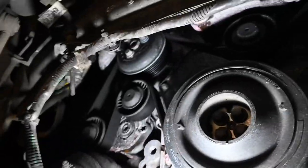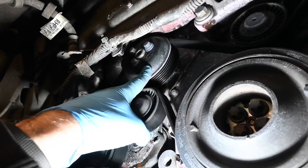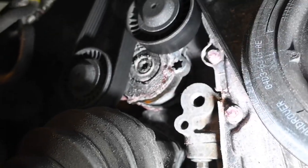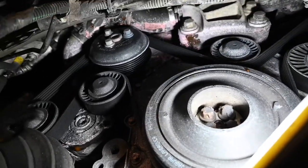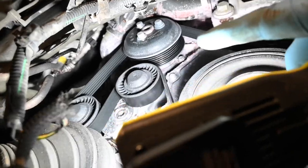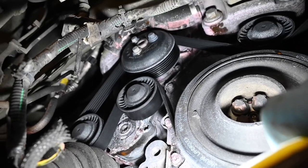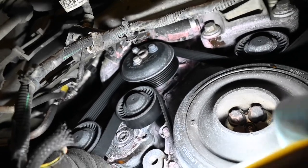Up here is the water pump. We actually have to take the belt off — the water pump pulley comes off separately to the water pump with just three bolts. You can actually see a little bit of fresh wet coolant just there, which has been dripping down and is completely covering the entire engine. What's happening is the water pump is leaking, but because it's spinning really really quickly, as it's leaking it's just throwing coolant all over the place — which is why we're replacing it.